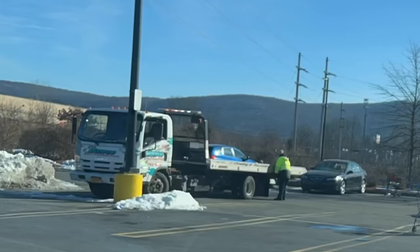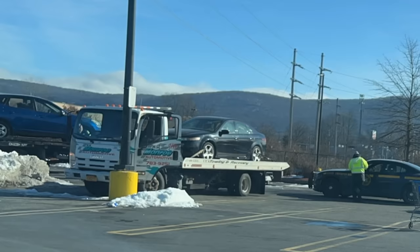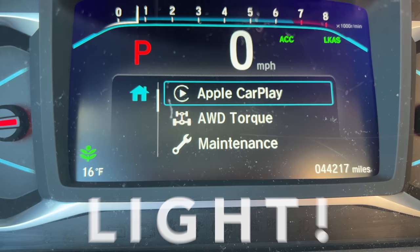Those weights pop off, and then next thing you know I have a strange vibration induced by that weight falling off. I might think that's some kind of problem with the vehicle like a wheel bearing or an axle, but it turns out it's just a tire that needs to be rebalanced.